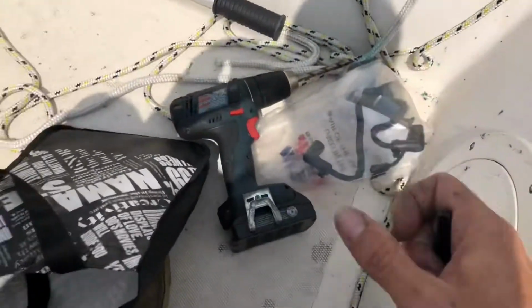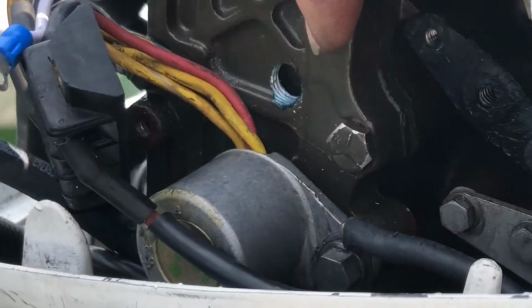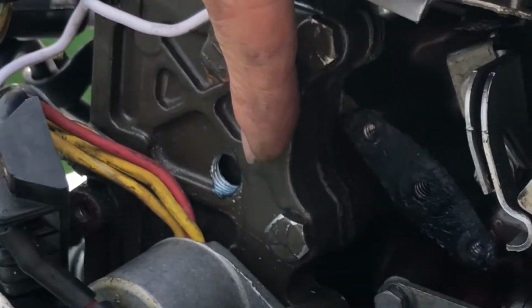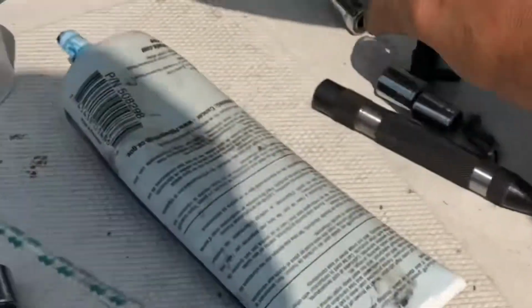I've just got some marine grease here. It doesn't matter what you use as long as it catches the filings. Caution here, I was told not to turn too many times. So I've turned the tap about 4 or 5 times over. I've got a reasonable size, and it looks like the threads are nice. I'm going to try putting in the L next.